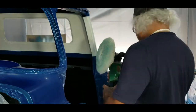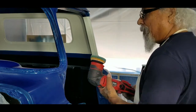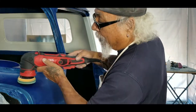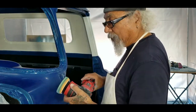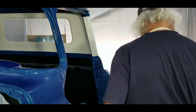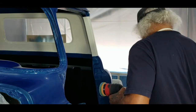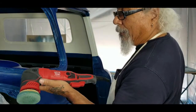With these new polishes, these things are pretty good. Because it's small it's taking me a little bit longer, but I can get it everywhere. If I hit an edge, because it's an orbital sander it's not going to burn it like a rotary. That rotary hits the edge and it's going to burn real fast.